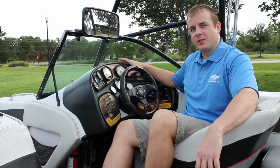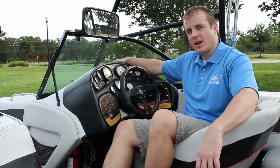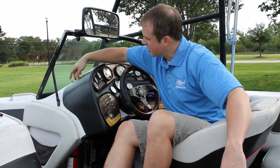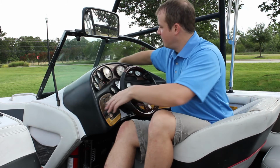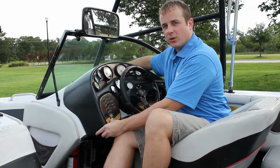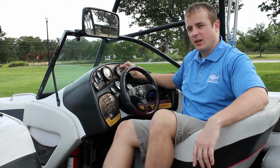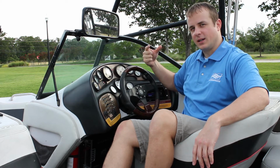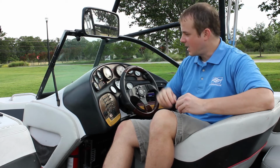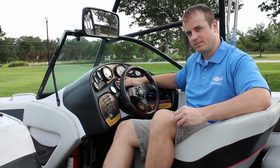We're going to be replacing the right speedometer, and in order to do that we need to gain access to the back of this dash. So typically they're just screws that you'll need to undo, and the dash pod will move forward. That way we can take the screws off and remove the existing display, put the Ridesteady display in, and then install the screws from behind. This will also let us gain access to the tachometer, where we will connect the RPM sensor.